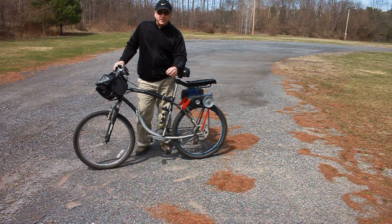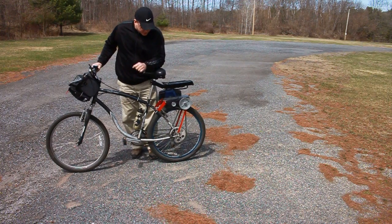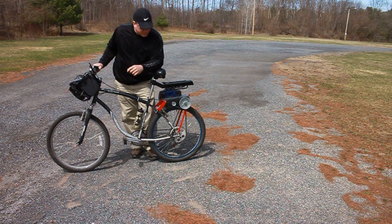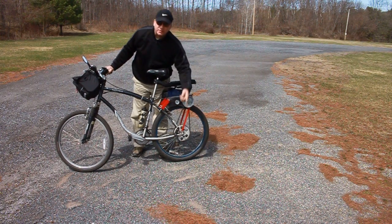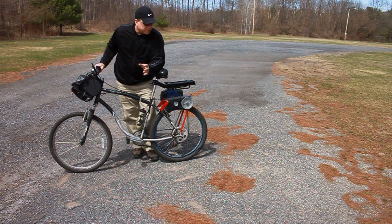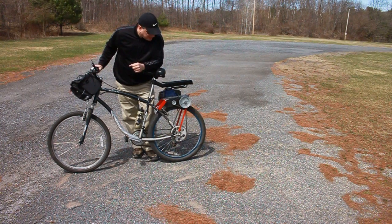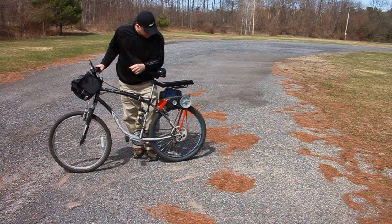I'm a 225-pound rider and this is about a 2-horsepower engine listed as 52cc. If you go to a smaller engine, you'd have to go to a larger sprocket — up to 60-tooth is available, so that's really no problem. Between a 43 and 47 or 49cc engine, about a 48-tooth, maybe 44-tooth sprocket, should work fine with this particular gear ratio.